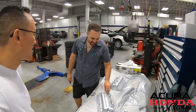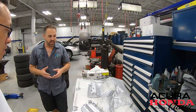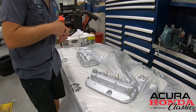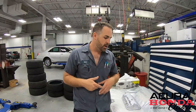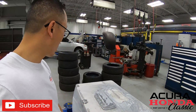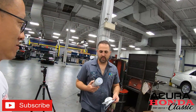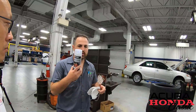They actually look better this morning. That paint kind of dried, and we don't use rattle cans all the time — it actually dried matte. If you want matte, that's okay, but I think we want a little bit of shine because that's going to help keep it clean and look better. So we're going to put a little clear coat on. I ran to the same store and got an engine enamel clear coat — it's rated for high heat as well. I think this is really going to make it look good.